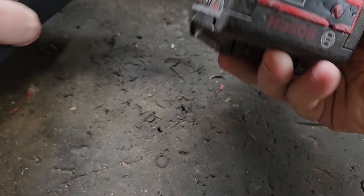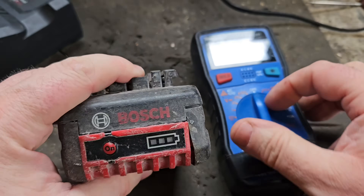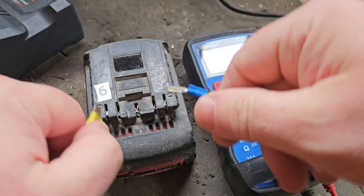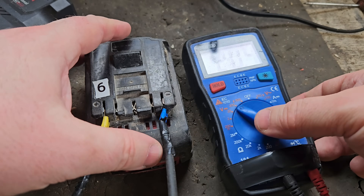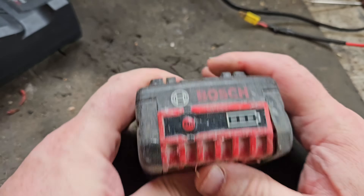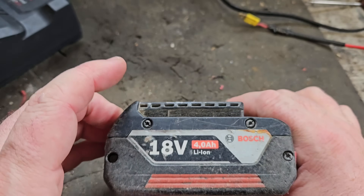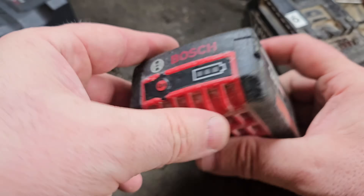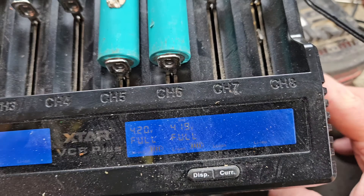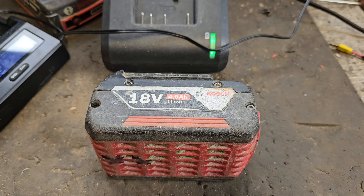This Bosch is fully charged now — it's showing all lights. There's a bit of a hasty job on the side I can fix later, but the main thing is the voltage: did we achieve maximum voltage with this cell replacement? And we did — 20.4 volts. That is perfect. So that's battery number 6, the 5th one we've got going. It's perfectly balanced and perfectly good. That's how you do cell replacement. I've got a couple more cells to pop into the next one — they're fully charged in the charger now — so that should be a handy job for the next video. If you like this video please give it a thumbs up and check out my channel.